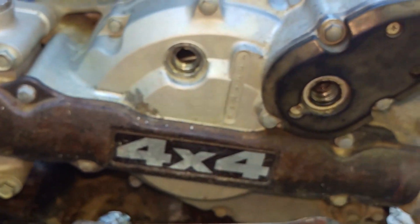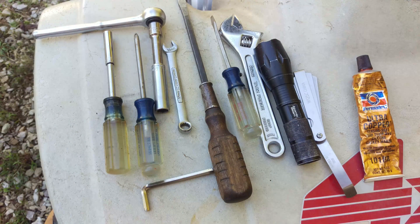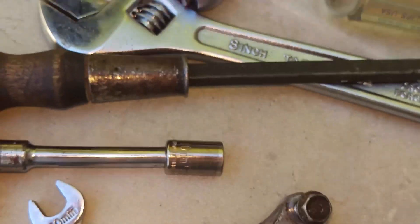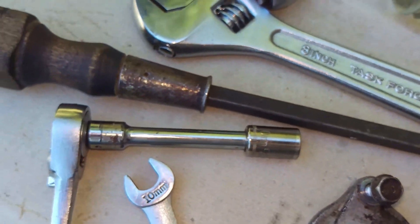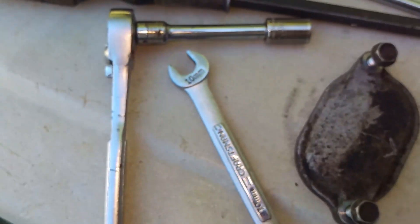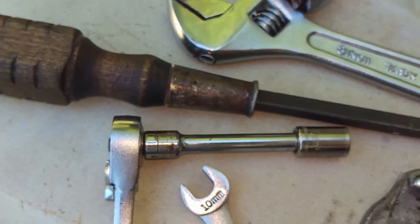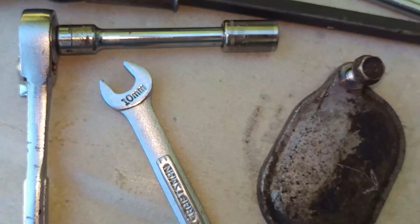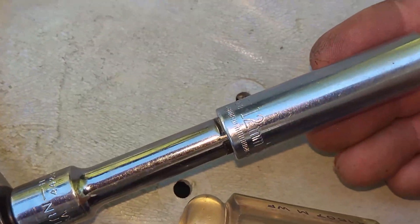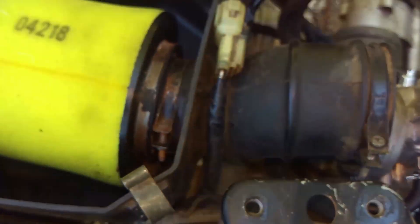Once I get that adjusted, I'm not going to have all the tapping that I had before. This being the crankcase, I might put a little bit of sealer on it right there. These are some of the tools you need: I had to use a screwdriver to move the one cap, and a crescent wrench because I couldn't turn it — I pushed in and snapped it loose. 10mm for the covers, 10mm extension to get to the top where the carburetor is and to remove the frame parts, 12mm. Phillips to take off all the breathers, and the intake had to be taken loose there.